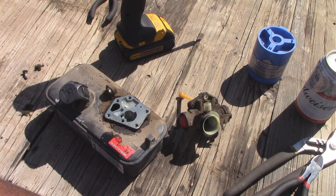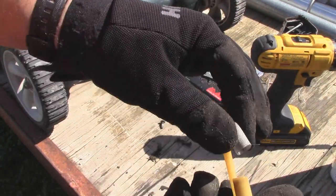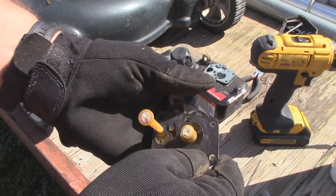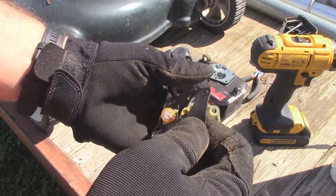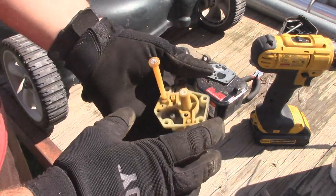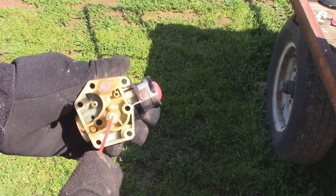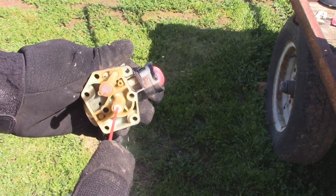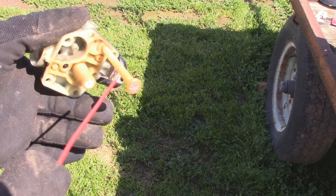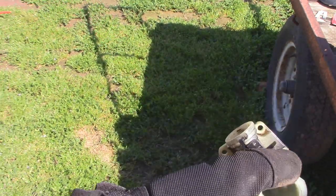We'll just set that aside. Now I'm going to go ahead and dump the tank and clean that out. When you service these things, it's always good to give them a quick spray off — make sure they're clean. Remove your screen here; you can inspect it if you want, but usually they're not too dirty. Now here is your diaphragm — set that aside — and we have another small spring. Now we can see the underside of the carburetor. The best way to clean out carburetors is most of the time just use a short, quick squirt — and that's coming out of the front there. Spray out the screen and give the underside a few quick squirts. Now it's nice and clean.